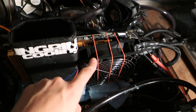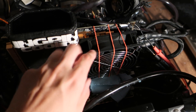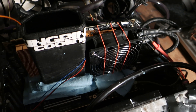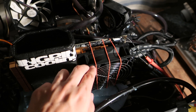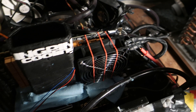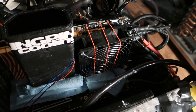I also changed the cooling fan on the VRM heatsink to a custom Delta fan, as the VRM gets quite hot when you run 1.5 volts plus on the GPU voltage and 2700 plus on the core. This is a decent fan — it is loud but not too loud — and it has enough airflow. It's safe to use even from a motherboard 3-pin header, so there's no risk of burning it.